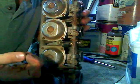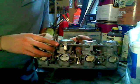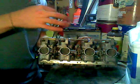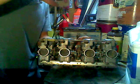The idle needles are adjusted with just a standard flathead screwdriver — small. You want to make sure it fits perfectly, because these are brass needles. They're called needles, but they're actually screws with a needle tip. So you undo these or tighten them. When you're taking these carbs apart to clean them, you don't want to adjust the needle depth, because typically you never adjust it. What I always do is I count the rotations — half rotations or full rotations, typically half rotations, because it's more precise.